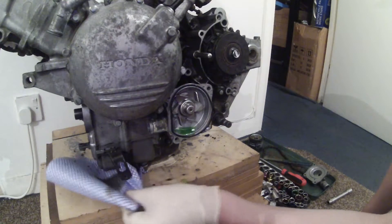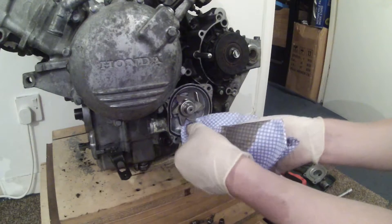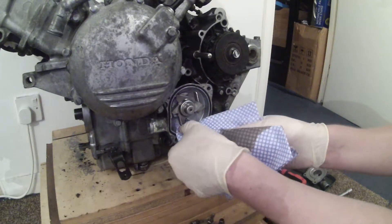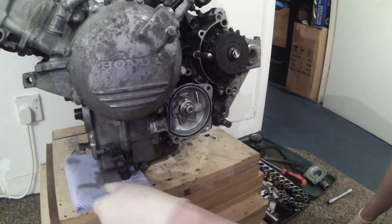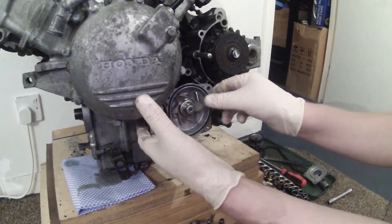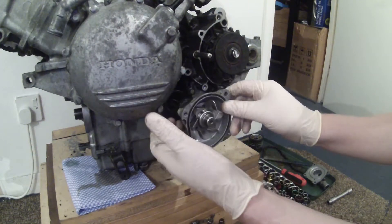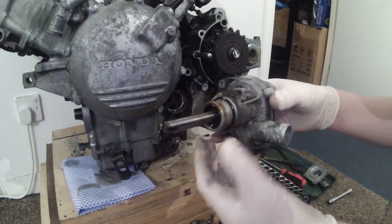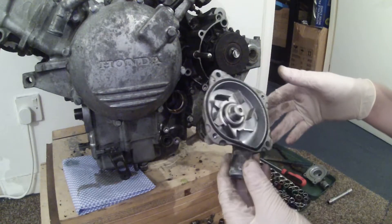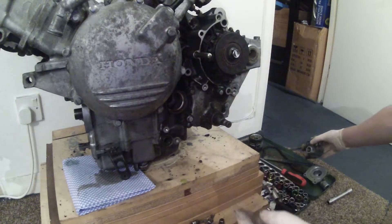Now we have a bit of antifreeze here which I'm going to clean up. The antifreeze actually looks quite clean, which is a good sign — it suggests that the engine has been well looked after. I'm going to see if I can work this loose. There we go, that's the water pump. There's lots of dirt on there but that should clean up quite easily. The O-ring seal and a bit of oil on there — perfectly normal water pump. I don't see any issues with that, it just needs cleaning.